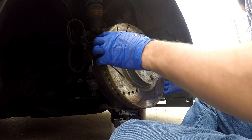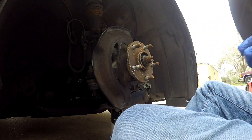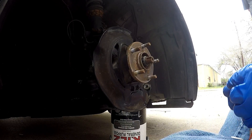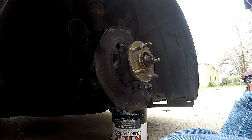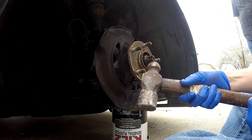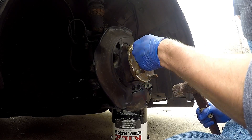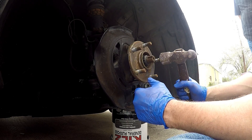See how well that paint can works out - it's the right height for the caliper. At this point if you don't like loud metal on metal, it's a good idea to have some ear plugs so you don't hurt your ears. Get your hammer and you're ready to hit your stud. You don't really have to worry about putting a lug nut on there because you have a lot of room after you kick it out.